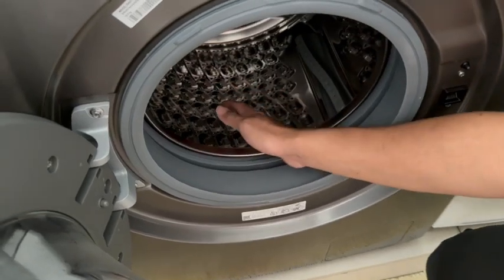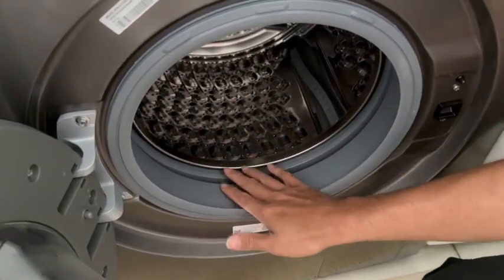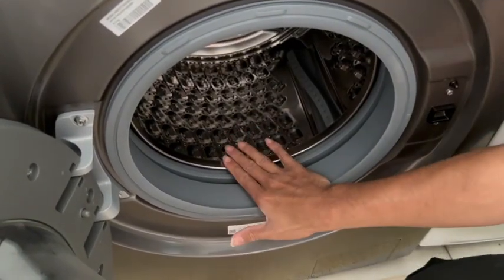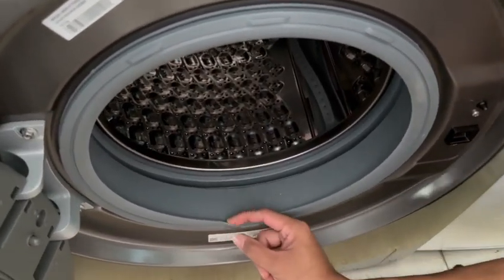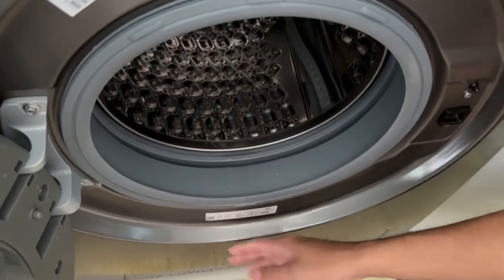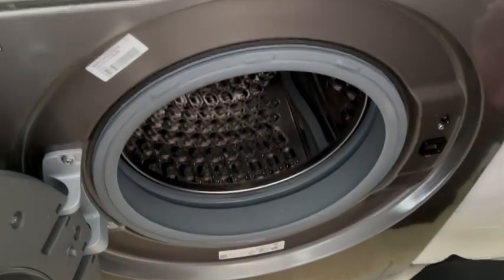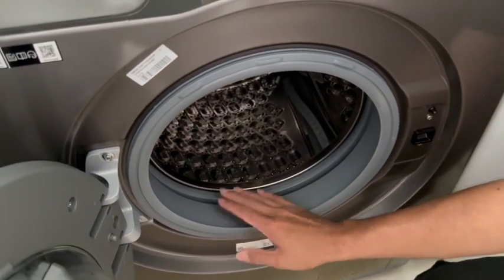Okay, so after washing, take out clothes. Don't drag. Because sometimes when you drag your clothes, right, it happens that, let's say the jeans zip is facing downward. You will cut. So this cut, they will experience one hole. One hole, when washing, you will experience water leakage from the door here. All this rubber cosmetic stuff is not under warranty. So must be careful, lah.